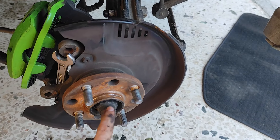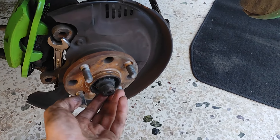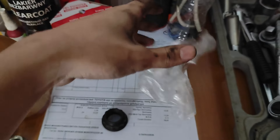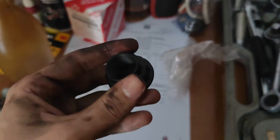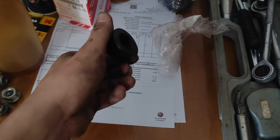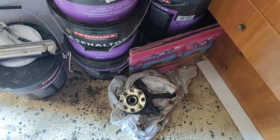If we're able to remove it — the last thing is to remove this one. I think it's a 19mm but it's a special type. Alex has it; he did it on his Celica and the number is the same, so he's going to bring it. The part number you're going to need is 90 177 22 001. It's this little thing that you cannot reuse the old one because there's a little edge that you tighten to torque and then hit to secure — it locks it. You're going to need that. And this is the new knuckle — a bit rusty — and this is the old bolt I just removed from the car.